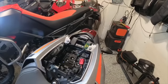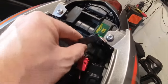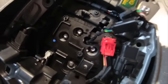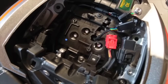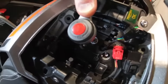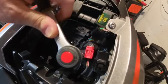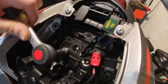We're going to take the seat off and start getting into this installation. One of the things you'll notice is underneath the rear cowling you'll see the cable that leads to the existing rear light, which needs to be disconnected. There are four nuts here that will need to be removed, so we'll grab a socket and remove those — pretty easy, just a small six millimeter socket.